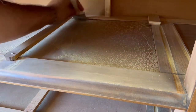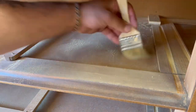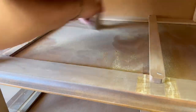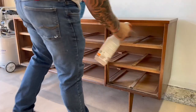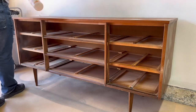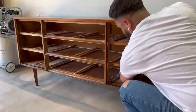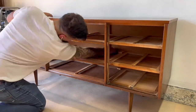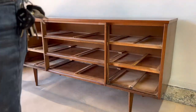I'm using a painter's brush to loosen the dust as my blower wasn't able to remove it all, in order to prepare it for a well-needed cleaning. I'm still using TSP as my main cleaning degreaser, which after wiping down will need to be gone over with a clean towel and some water to get rid of the light tacky residue left over.